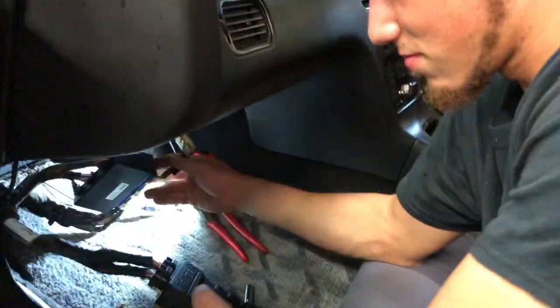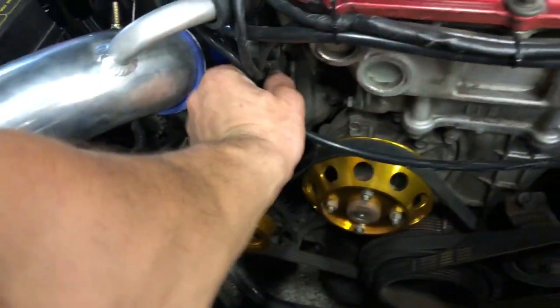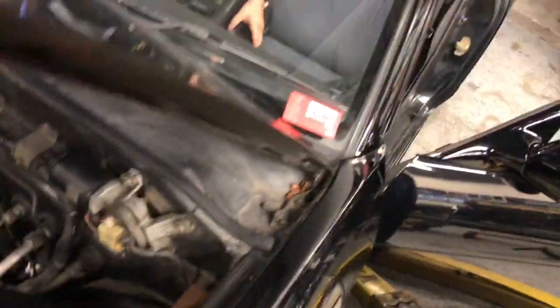There's still vacuum lines to sort out — I redid a couple of them over here. The MAP sensor line runs along the back, along the side, down through here. There's a little grommet I poked a hole through, and it goes inside to the Haltech. I have the cable from the Haltech run through the glove box as usual. Sadly I don't have a wideband right now — I'll be getting one maybe next week. But Bert Bob is here, the key is on, the Haltech is getting power, and we're ready to load a base map.